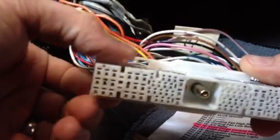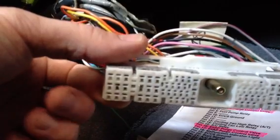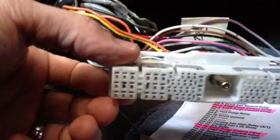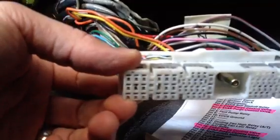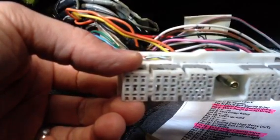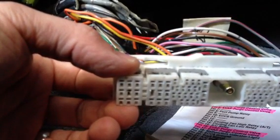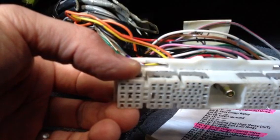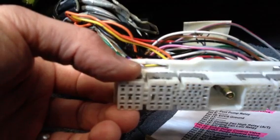So this thing is ready to go. I know there are some signal wires that go into the older style ECU from the newer one that cause some idle issues, which should also be pointed out in the thread. So hopefully this gives you a little bit of an idea of what to do — you can do it yourself, pull the pins right out, switch them around, and get the ECU that you want, a tunable ECU, into your 99 or B15, P11, whatever you want to call it. Good luck with your project, take care.